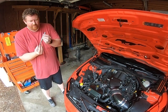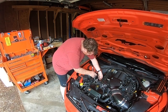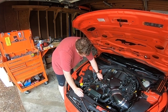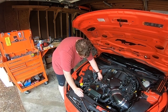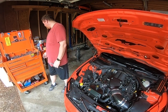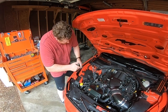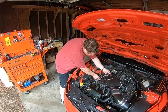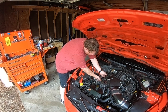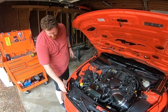Put the plug back in your plug socket, drop it back down in, and run it down by hand. Then you want to torque these — I like to use the factory spec even though these are not factory plugs. The factory torque on these is 12 pound-feet, which is the same as 144 inch-pounds. I've got this set, so I'm going to stick this on here, hit it a few times, and pull that guy out.